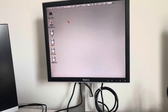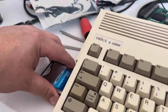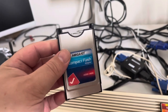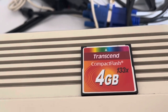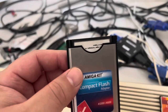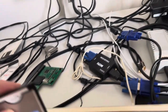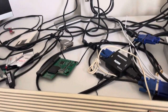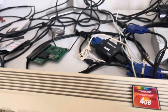I don't have to keep ripping my Amiga apart to put files on it. If you're having weird problems with your PCMCIA on your 1200, and even if you're using like 4GB or even 2GB Transcend type drives, get your hands on one of these Western Digital Silicon industrial type card drives. They're on eBay all over the place, different sizes. I have a 2GB, I think a 4GB, and then a 512MB one.